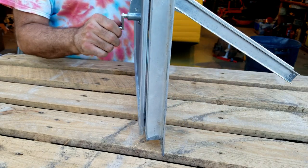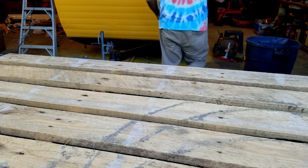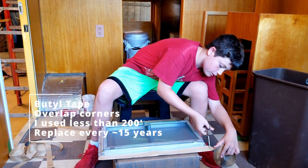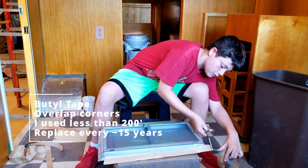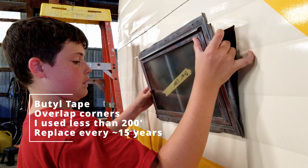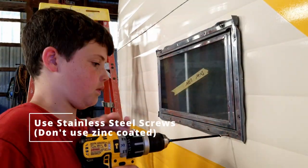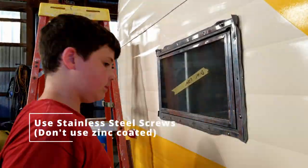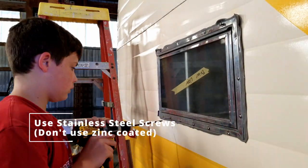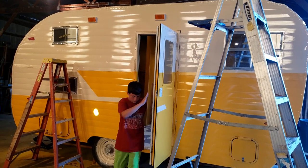Test to make sure it opens and closes. The third and final area a window seals is around the edge where it connects to the trailer — we're putting new butyl tape here. You want to replace this about every 15 years. Make sure tape overlaps at the corners where two pieces meet so that seal is really tight. When screwing it in, don't overtighten so the frame doesn't shift and crack your window. Make sure there's a little squeeze-out of the butyl tape when tightening — that ensures a good seal.